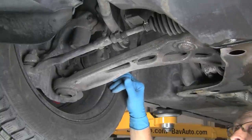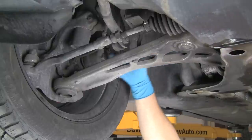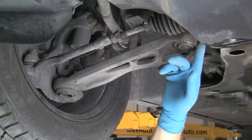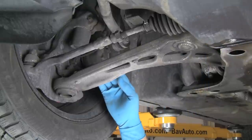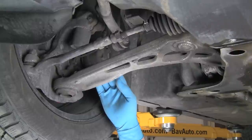Finally, if this were a four-wheel drive car, we would have an axle going through here in the front, with a boot on the outer end and another boot on the inboard side. Inspect those boots for cracks. If you have any cracks or evidence of grease coming out of the boots, you should replace the boots before the axles go bad. We'll show you how to inspect the axles when we do the rear of this car.